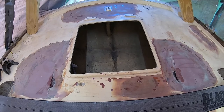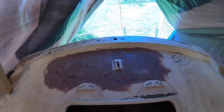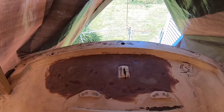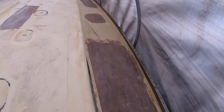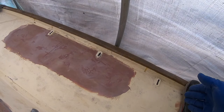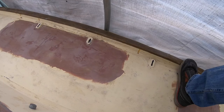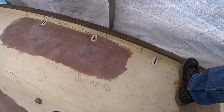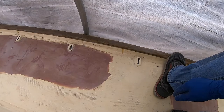Back to our show. One of the things about putting in the outboard well here is this chain plate, which attaches to that knee there - it can't remain internal, it's got to be external on the outside. So I've got to build one of those or have one made. I'm thinking I'm gonna do it for all of them. These three shrouds - the wood knees underneath are pretty rotted, and I have to completely rebuild all those. Honestly, I think it would be easier to knock all that out and smooth it over, paint it, and put in external chain plates with good backing plates.